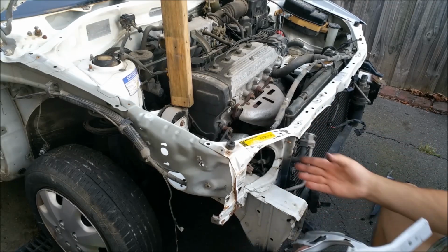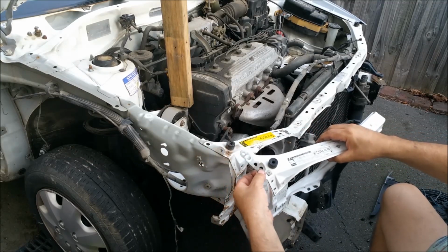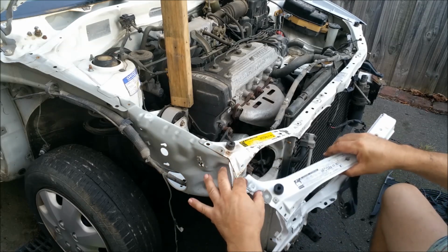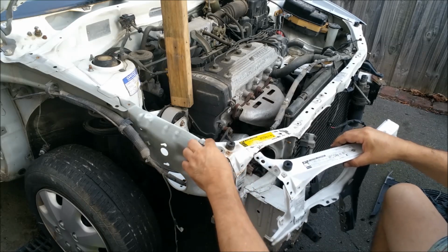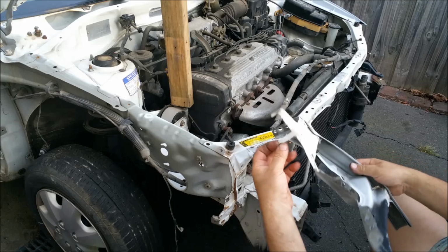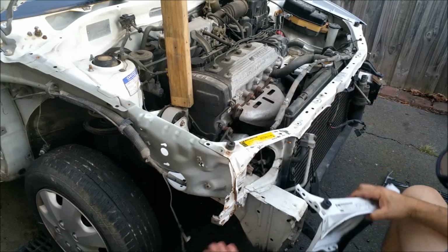But I can't do anything with this. It just looks terrible. And so once I've done that, I can plug weld these right in the original locations, which are there and there. That one stays open for the front guard mount. That one's a sort of a lining up hole, an alignment hole. We've got plastic clips. We've got this one, which isn't broken. The original one's all busted up. You know, it's just a better way to go.